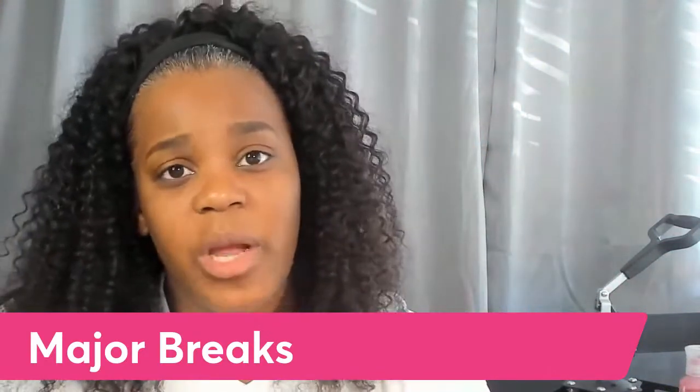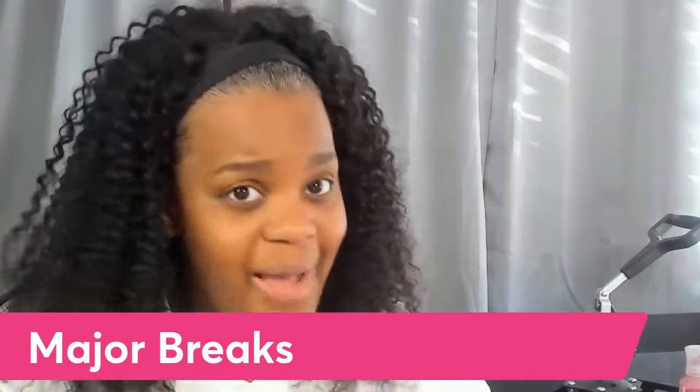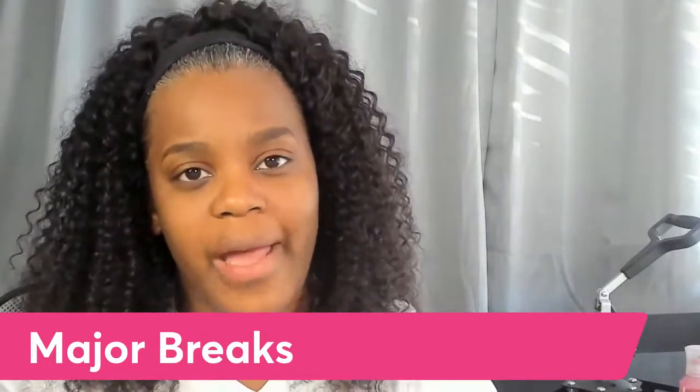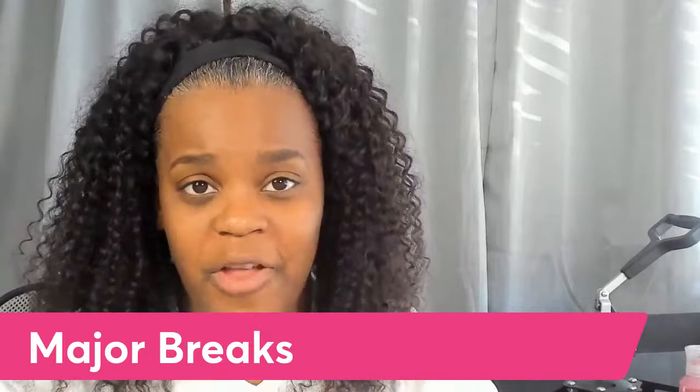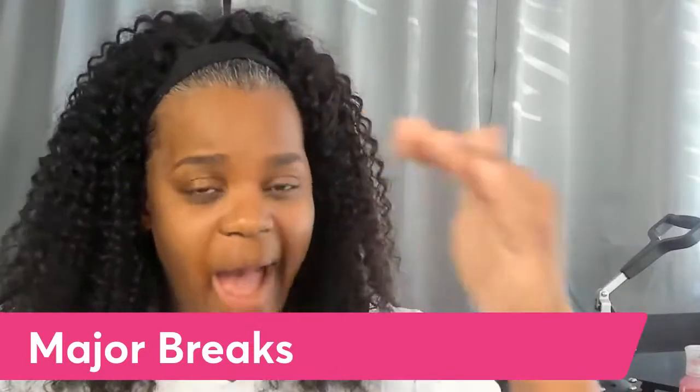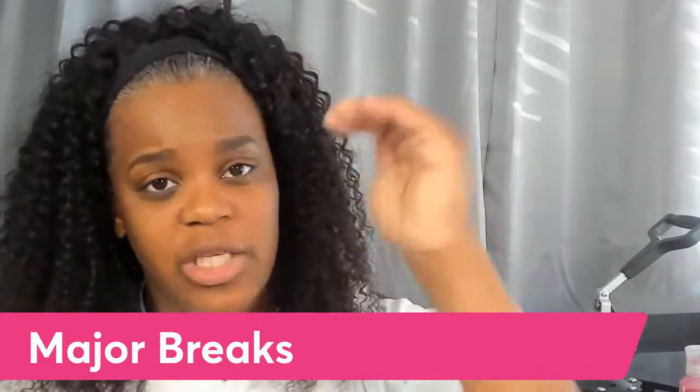And then there are times where it's going to be your print head. So if you do a print head cleaning and it does not clear it, do not continue to do print head cleanings. Take these things out, check it. If all of those things are checked off, then the next step is to do what's called push air. I have a video on that. All of these things I will have in the description saying, hey, this is your next step.